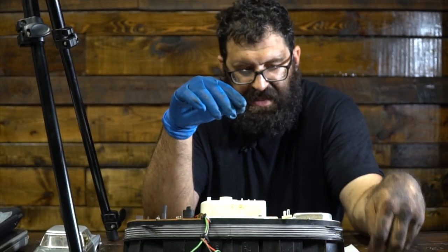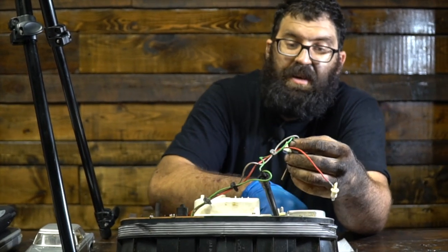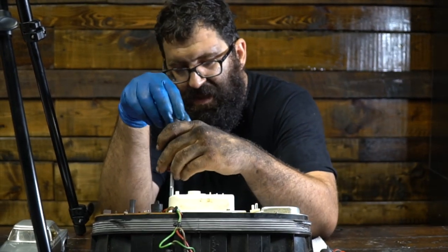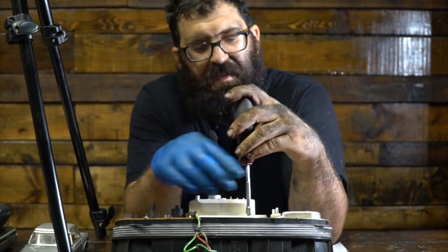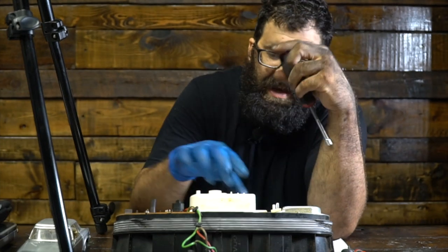The first thing you do is you remove this little assembly right here that has the low coolant light, the washer fluid light, etc. on your 560. Then you're going to remove the long screw for the dashboard lighting rheostat and set it aside. And then we're going to remove the rest of the 6mm screws.